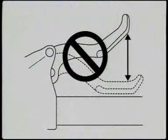Do not continually squeeze and release the lever at this point. Otherwise, air bubbles may remain mixed in with the oil inside the caliper, and it will take longer to bleed the air. If you do that by mistake, drain out all of the oil and then add oil again.